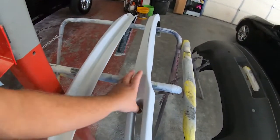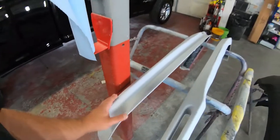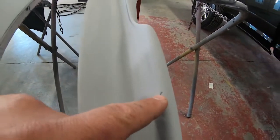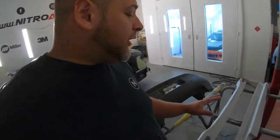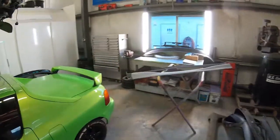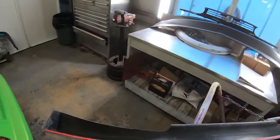We have our Volkswagen Jetta Fascia and Varis tribute lips — the front lip and the rear lip. They're pretty much prepped out but need a little bit of repair still — a couple of pinholes, a couple of scrapes and blemishes. We're going to mix up some filler, come in with a razor blade, and scrape in any little blemish you see with the guide coat left in, then wet sand those little spots, blow them off, and get them in the booth ready to paint. Walking over here you can see we have our side skirts still in primer and guide coat. We'll prep those out as well and get the whole lip kit in the spray booth and get it painted up.